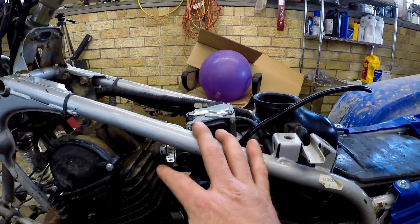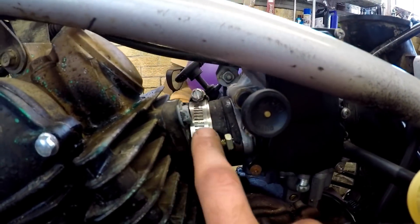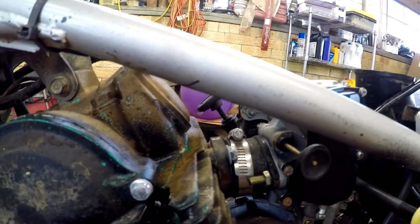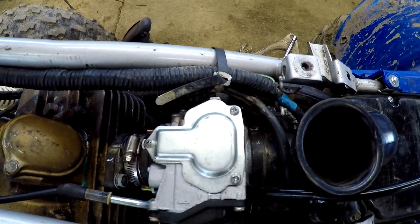All right, I got all my plastics off, my gas tank off, and I'm in here to the carburetor now. I think before I take the time to pull this out, we're going to open up the top and see where our mixture is set — whether it's lean or rich — and maybe play around with that a little bit first. If our jets are a little too aggressive, maybe I can lean out the mixture and that'll help keep it from bogging down under throttle. Also, this is not the correct intake boot for this Warrior — I did order a new one and it is on the way.